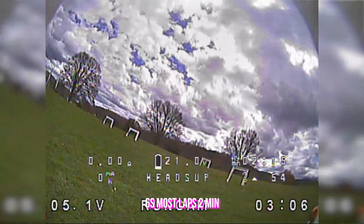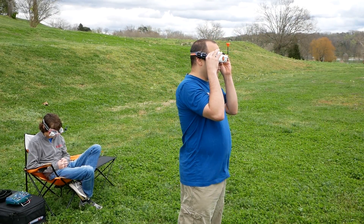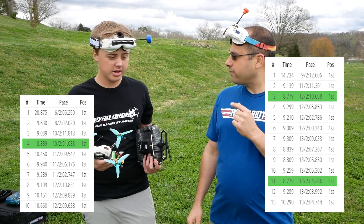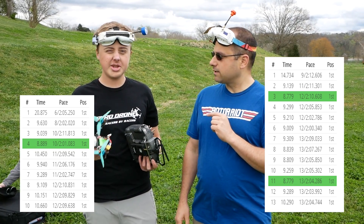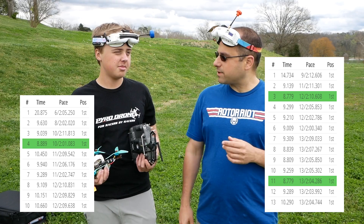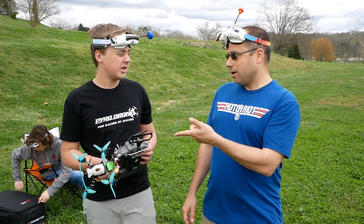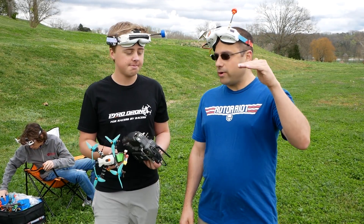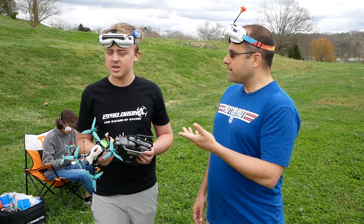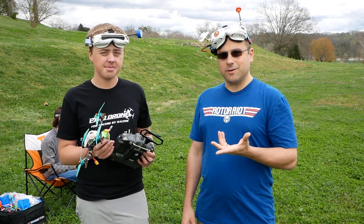And the total laps count — 21.4 volts, with the lowest being 20.4 volts under load. Let's see how many laps that was. How many laps on 4S? 11 laps on 4S. How many on 6S? 13 laps. And the laps were faster too — you were putting in about 10-second laps on 4S versus 8- to 9-second laps on 6S. And watching your voltage, you could have gone longer — at least another lap or two. You never hit that voltage cliff like you do around 12 volts on a 4S.